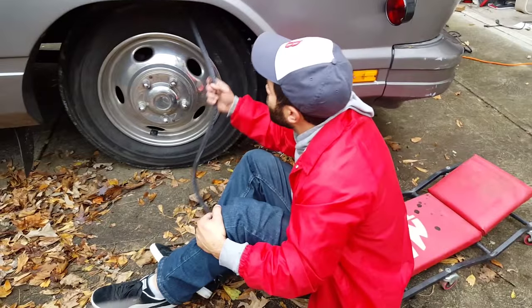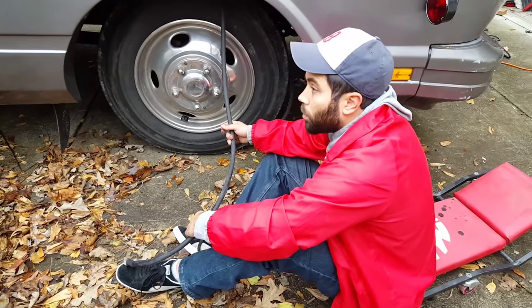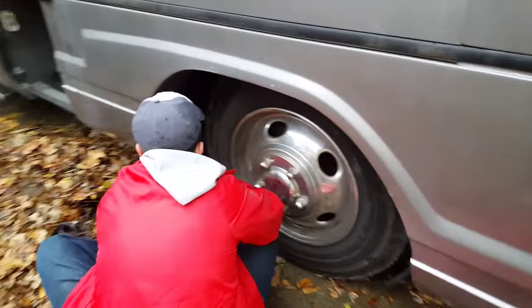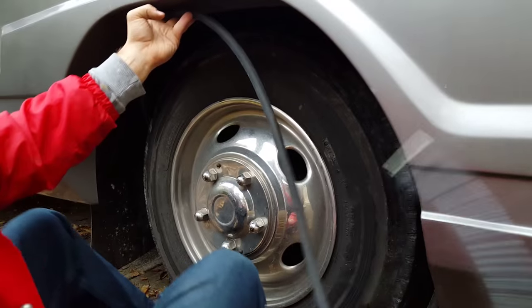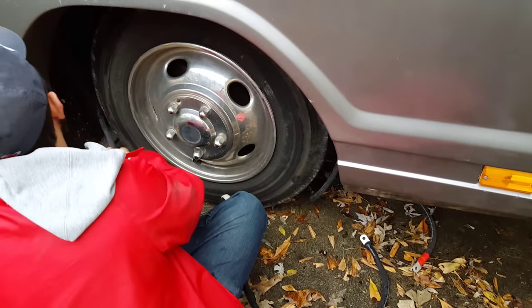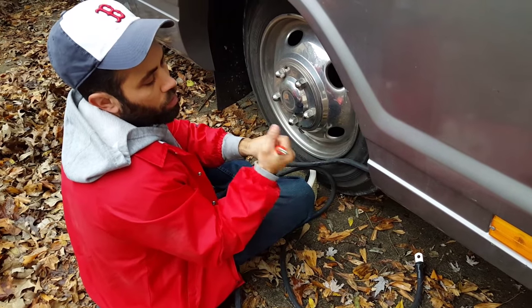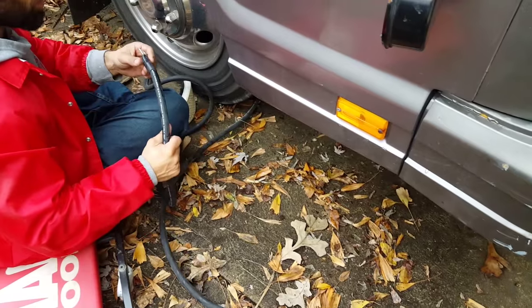The bitch of it is it's a big welding cable. It falls about a foot short, which kind of sucks. Otherwise, I don't want to go on this side of the wheel, there's too many moving parts in there. By the time I get it, if I come up over here and I button it up real tight, it's going to make it to about here, which won't get me to the battery. At least on this side, I got to put a fuse connection. I got to cut this anyway. So I could just cut it at the end and then just get about a foot of wire. I don't really want to splice this big thing.